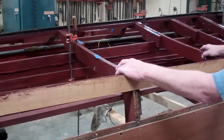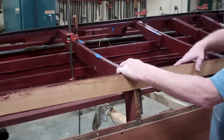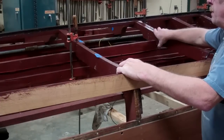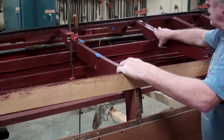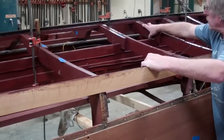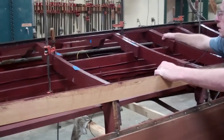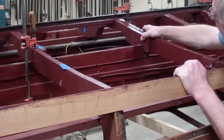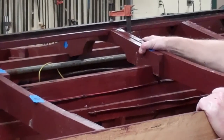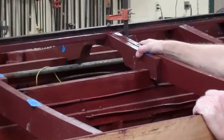They just put the main frames in and left out the intermediates — and that's directly beneath the engine. We're in the engine bay right in these two areas. The cross members ahead of the engine are good structural braces, but when you get underneath the motor they have it notched out for the oil pan, so you don't have a lot of strength right there. And then they left out the intermediates.